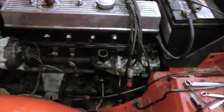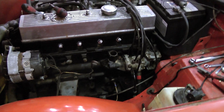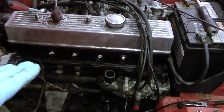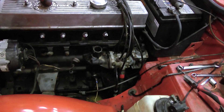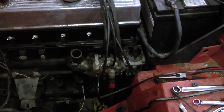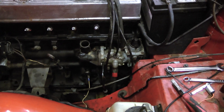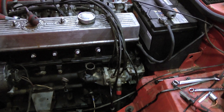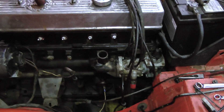The only trouble I'm having currently: basically this thing will not start - it wouldn't even try to fire before, and it's doing the same now. So we've got a new coil because the spark's not looking great. I'm going to whip out all the plugs, time the engine up, and once I've got that all dialled in I need to have a look at this, make sure it's timed up right - which is why I'm not too concerned about the fuel leak, because it's probably got to come out again. I want to make sure the motor's timed up so we can eliminate that factor, because these units start at about £200. The condition inside is really good - I don't think he needs one. And this is a favour job - it piqued my interest.